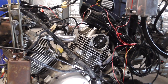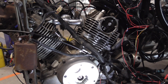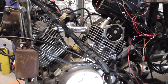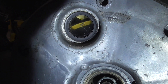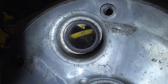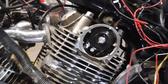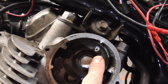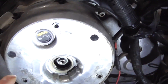To test this theory on whether the sequence of firing impacts the front cylinder being lean on single carb intakes, I'm going to reset the timing. If you're not familiar with the timing, you look down inside your little sight glass and you can see I've got it set where the arrow is pointing to the T. That is the top dead center of cylinder number one, which is the rear cylinder. When I'm sitting on T, I should be pointing upwards right here — I put a dot on it, so it ought to point up to this little arrow. It might be 180 out, in which case you rotate your crank around another full rotation to get it up to the top.